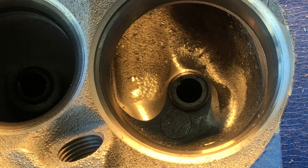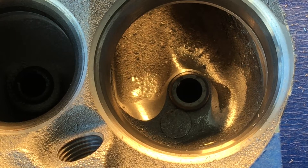When you remove that swirl ramp, you're going to take off the bulk of your material right at the top of the ramp. We're now changing our airflow properties more towards mid and top end power. Just in case you guys aren't familiar with port bias — most all ports in a cylinder head are going to have a larger, higher flow side and then a smaller side. When you hear people talk about port bias, they're talking about how one side of the port is larger and will flow significantly more air than the smaller side.